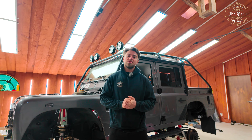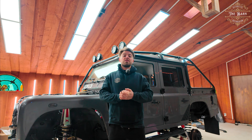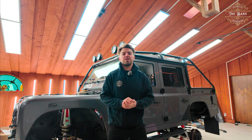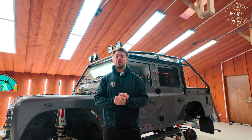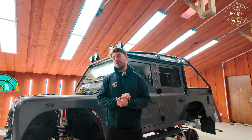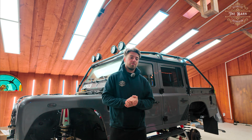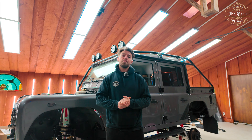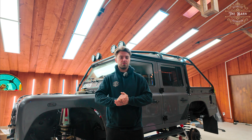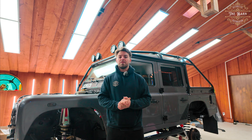Hello and welcome back to another Barn Automotive YouTube video. In this episode we start on the LS3 engine installation along with the automatic transmission. I start by dry running everything outside the car — plugging in the entire wiring loom and making sure I have all the sensors in the right places before moving on to the installation in the car. That way I can also make a good plan for where I'm going to run all the wires to tuck them away.